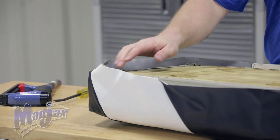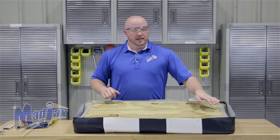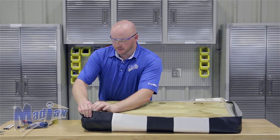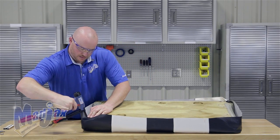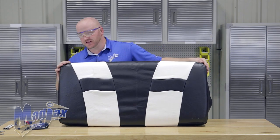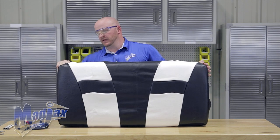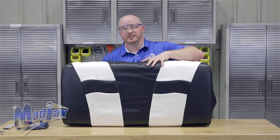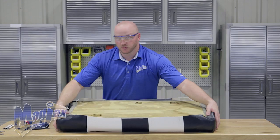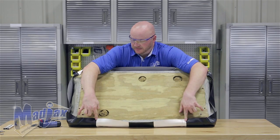It's okay if you cover up your hinge holes — we'll cut it out later. Now we're going to go to the complete opposite side of the cushion and secure this corner. The reason we're doing this is because if you pull both sides you may end up with a cover shifted to one side or the other. Again, pull the fabric over, check the stitching on the back side of the cushion, make sure that the stitching is even with the shoulder, and secure that corner. Now do the same thing on the other two corners. Once all four corners are attached, double check that you're happy where your corner stitching lays over the shoulder. Now move to the rear side of the seat and attach the outer two seams to the bottom of the seat cushion, making sure your stitching is in a straight line all the way across and that both seams are evenly spaced from the outside of the cushion.